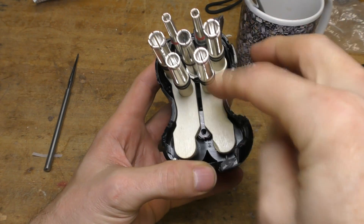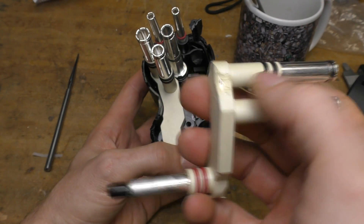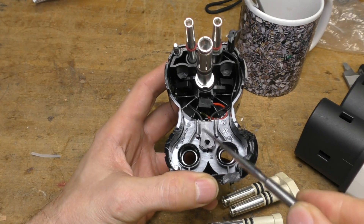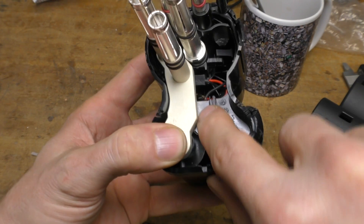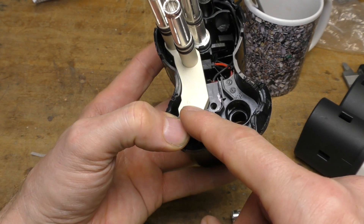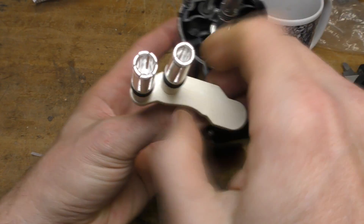This has got two pairs of pins, which seem to be a moulding of very hard plastic over a copper bar — the pins are likely riveted or welded into the bar. Inside there are two components. One is a thermal cutout. You can see that both bus bars rest on the back of this thermal sensor, and I think there was some sort of thermal pad on there as well. So if you've got overheating of either pin on either bar on either side, both of those find their way to this thermal cutout — quite a neat way of achieving safety.